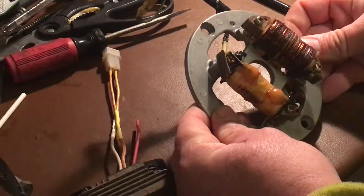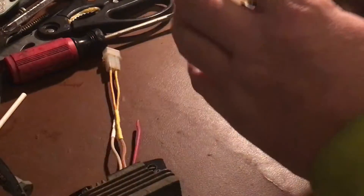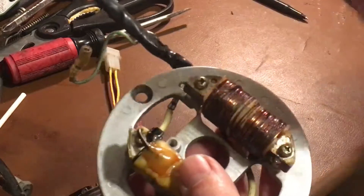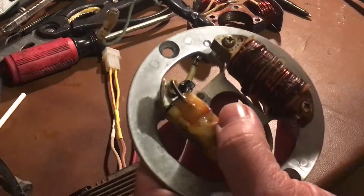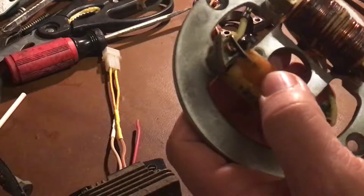After you get most of that cut out, screw it back on with the two back bolts. Take a pencil and draw the circumference lines on your magneto. When you drill the holes to tap them, don't go past that line — stay on this side of it. That gives you air gap clearance. You want the holes as close to the line as possible.